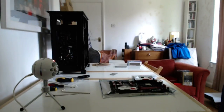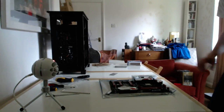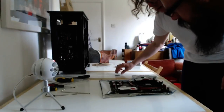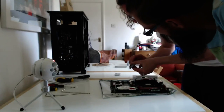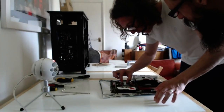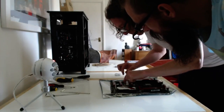Okay. Right, so you've got to get this in the right place because if I remember rightly, this uses some of the PCI Express lanes, and you want the 16 lanes, because it's super fast write speed. You want to get it in the right ones. So it's this one. This is the M2 drive. I'm pretty sure it's that side round. Yeah, you can see where the slot is there. Then you've got to get the right size slot. So it is this one here.